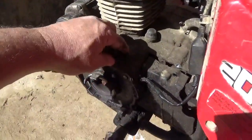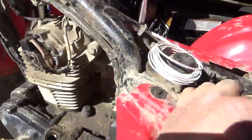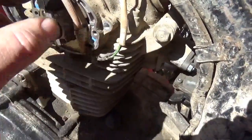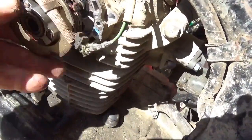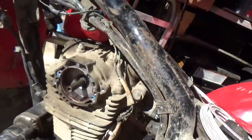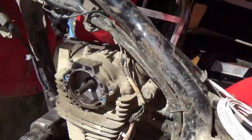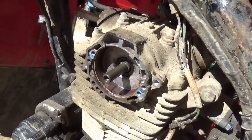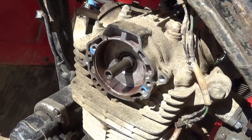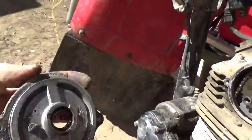You're going to have to take this cap off to see what your timing looks like. Outer cover — two Phillips, off. You got to take two Phillips here. When this comes off, there's a pin that's really easy to lose, particularly when you slide this outer cover off. I recommend taking it out of there — use a magnet. And then keep it on the magnet because you saw how tiny they are. Very easy to lose.